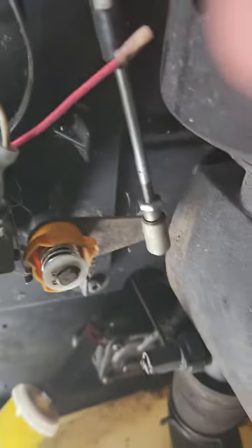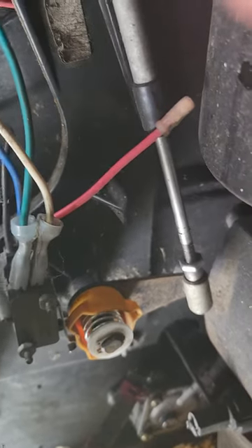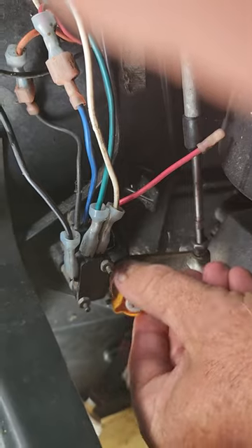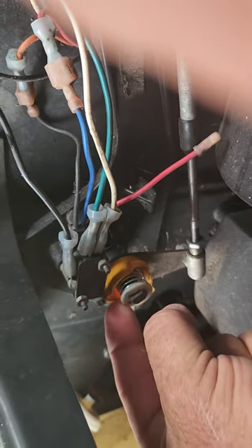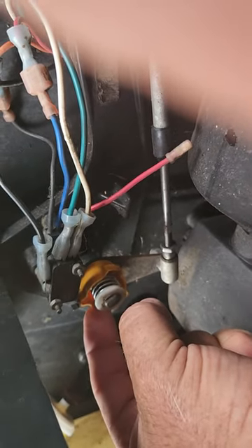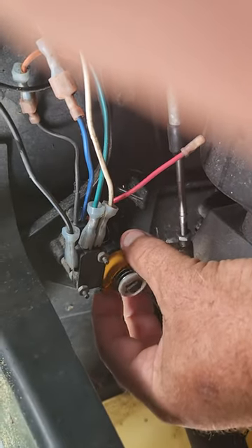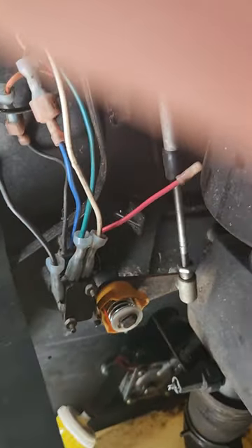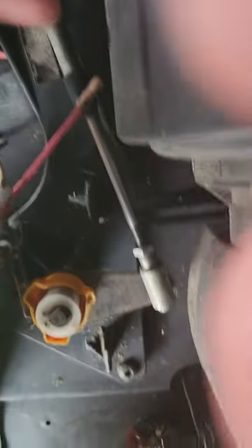Let's move up here to the forward and reverse switch — get right up in here and take a good look at it. A mechanic that works on these knows the rule of thumb is what we call service mode. We take it out and move it 180 degrees and push it back in. We make sure that tab is lifted when it goes back in. Now, no matter what we do with the throttle or starting, this cart's not moving on us. We'll chalk the tires anyway and make sure it's safe.